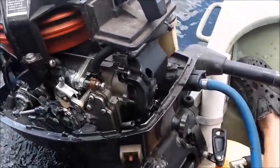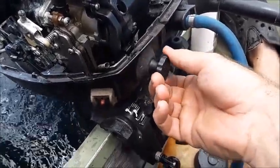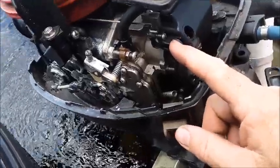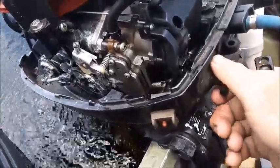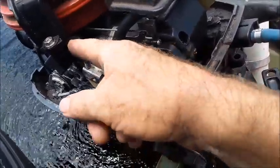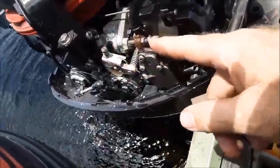It's going together pretty good, and interestingly this front knob — which says 'pull to choke,' but it's really just an enrichment valve — you can also twist it to slow down the idle or twist it the other way to speed up the idle. This rubber here is actually changing the spark advance when you twist the knob. You also have the adjustment on the carburetor, and then you have the adjustment right here which is also a spark minimum spark advance setting, as well as an adjustment here and an adjustment right there, which is the maximum of what it can do.